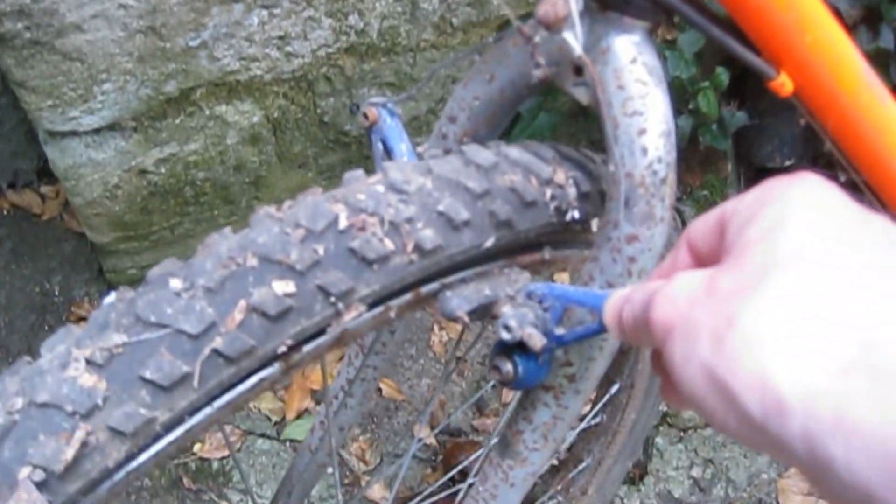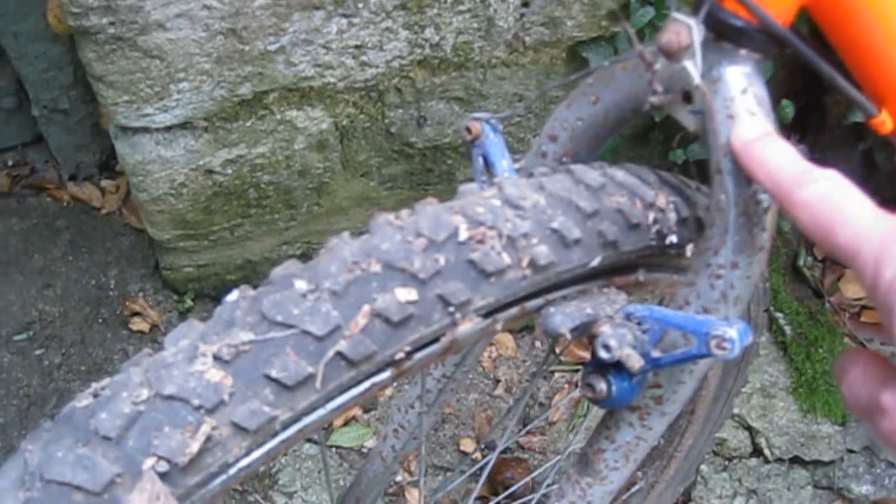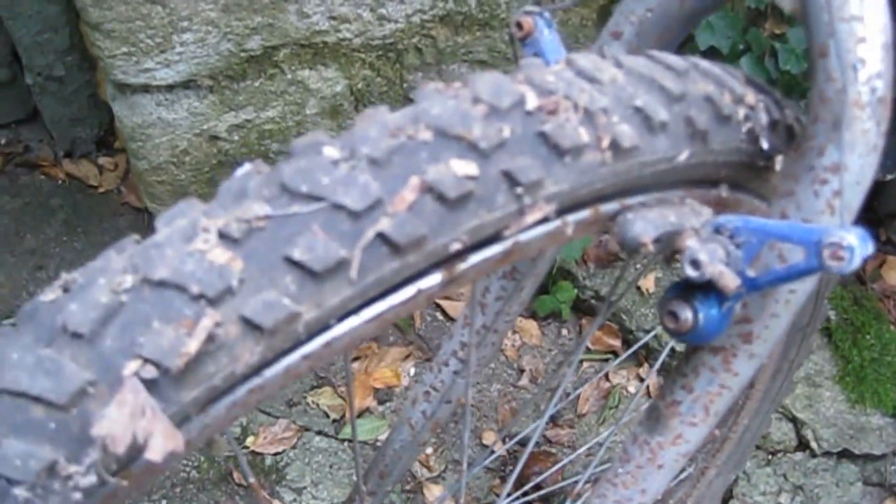It's got really old components on it, really cheap and nasty. The brakes do work. It's got really old Shimano gears on it, so this is all rusted. I think I'll probably replace all the brake levers and cables. I did change the front end to put V-mount brakes on it years ago and these were really nice chrome forks at one point, so these are going to have to be stripped back and probably painted. The rims look pretty much knackered, the tyres are completely gone — all split around, with insects and all sorts living in there. We're going to have to replace the tyres and tubes.